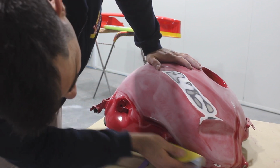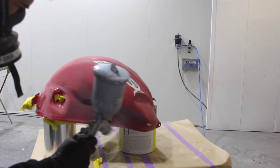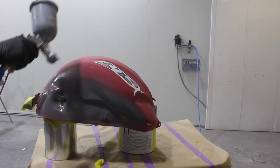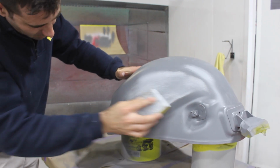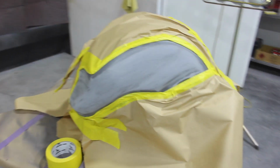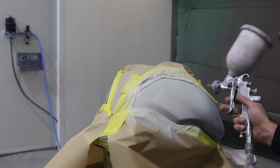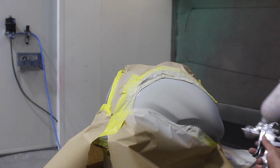So basically I was going to do some engraving on this fuel tank, sanded it down with 240 grit, then I sprayed some of the all you need primer all over the tank. I sprayed about 6 coats. I needed to get a thick build. Then I masked off this area because I only wanted to spray this small area. I used a spray filler.